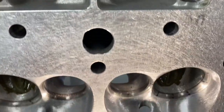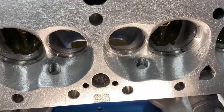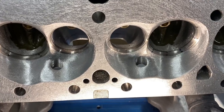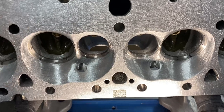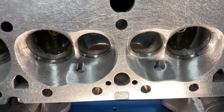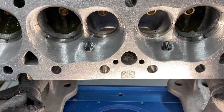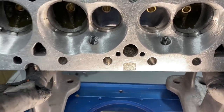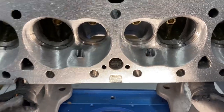You can see here these will get angle milled. These are going to Canada — they get angle milled. I get questions all the time. This is just because I got fingerprints all over from the epoxy work, so I don't like having a nasty looking deck, so I DA it to take all this stuff off. So this done will probably be — I think the rule is 62 cc's.